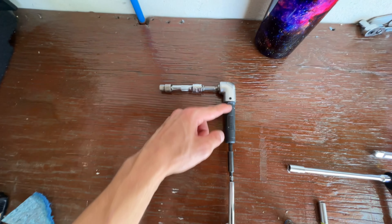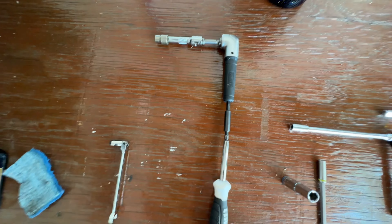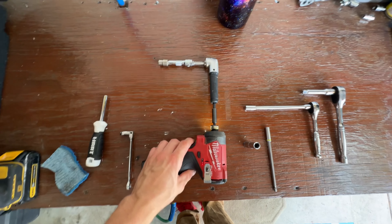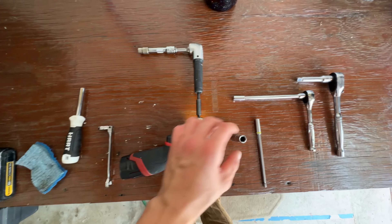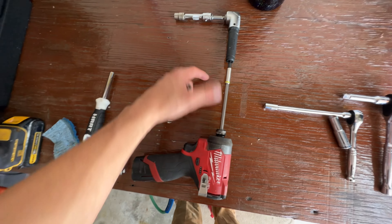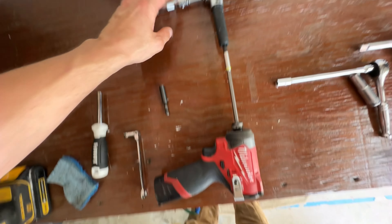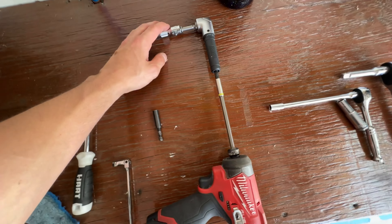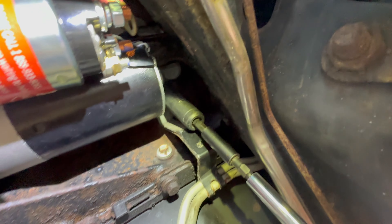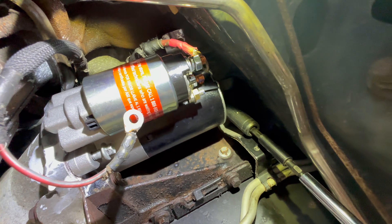This is the guy for the top bolt right here. I've got a screwdriver with a quarter inch female socket adapter and a regular bit chuck. Quarter inch by quarter inch male to female. And then I have this 90 degree tool right here — I'll put a link in the description where you can buy one. I got this Dewalt from Home Depot or Lowe's. Then I have a quarter inch by three eighths socket adapter, a short three eighths socket extension, and a three eighths by 10 millimeter socket for the bolt head. That gets you the perfect amount of distance away from that bolt to where this will clear the front of the starter.